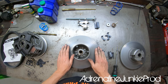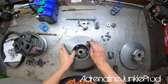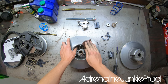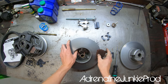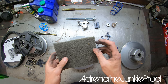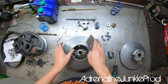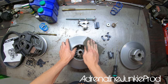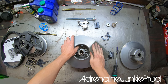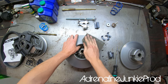Now we'll clean the clutch and scotch pad this side. I've got a scotch pad here — we'll go around the whole surface. Aluminum is a soft material, so we just want to take the glaze off and work a nice cross-hatch into it. Go evenly all around and don't spend too long in one area.